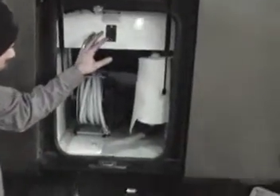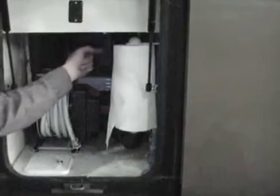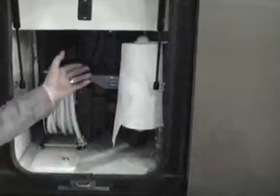The first thing I did was install the reel as close to a logical position as possible in this particular coach. Here it was actually pretty close to the water pump, which is where you need to attach the line to the pressure side of the water pump — in other words, the outlet side of the onboard water pump.